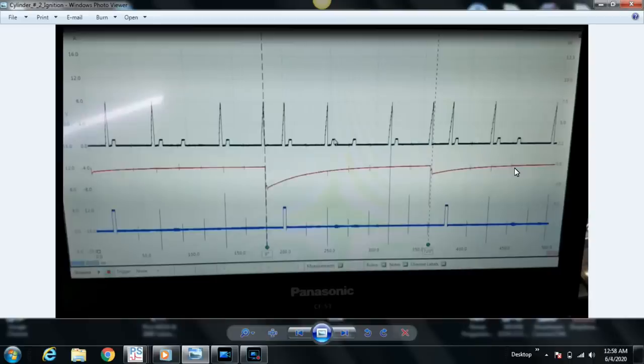Okay, we decided to do a voiceover at this section because there's a couple of missed opportunities that we wanted to take care of. One thing is we didn't mention the obvious thing, which you guys have probably picked up on, is the engine noise. You could hear that the engine is running rough, but you could also hear some engine noise at this point. One thing I wanted to bring up here is with hybrids, for any misfire, whatever the cause of the misfire, it's not uncommon at all for the engine to sound like it has catastrophic internal damage, at least on the vehicles that we're familiar with, which is Priuses or other vehicle manufacturers that are modeled after the Prius hybrid system.